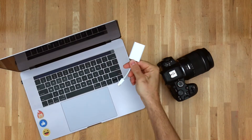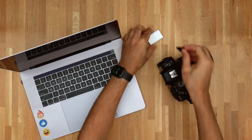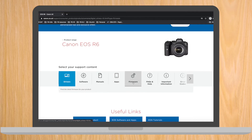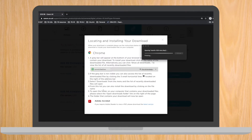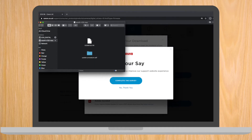Turn off the camera and remove the SD card. Insert it into your Mac. Now we're going to go to the Canon webpage and download two firmwares. One is the firmware for the R6, which we download. When we open the file, we're going to have a folder with PDFs with instructions, and a firmware file. Copy that to the SD card.